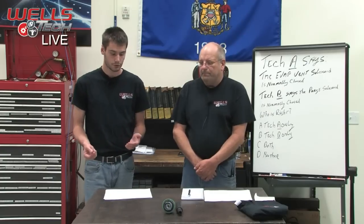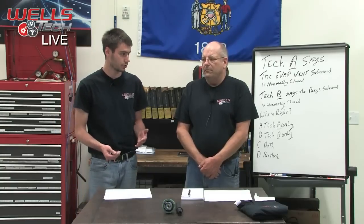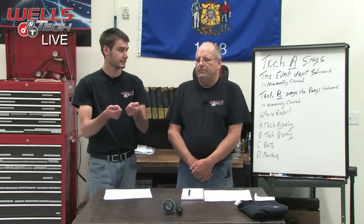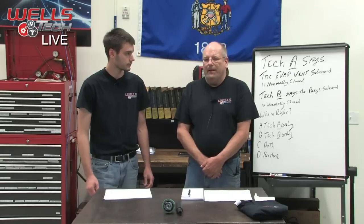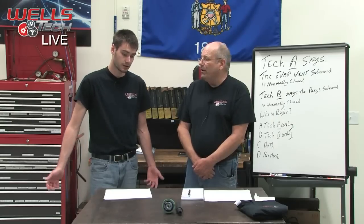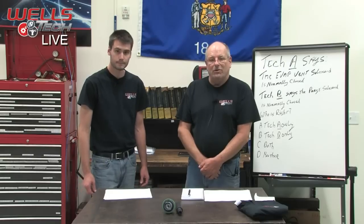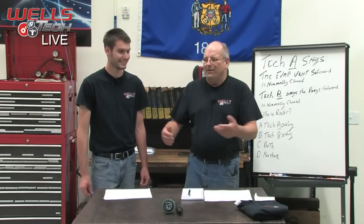Right. So then I did the same test with the solenoid turned off, ungrounded by the computer. I did the same test and I still read 12 volts. So that meant you were still getting a ground somewhere. Exactly. It could be a short to ground somewhere between the vent and the computer. So we haven't diagnosed that one completely yet, but we'll keep you informed.